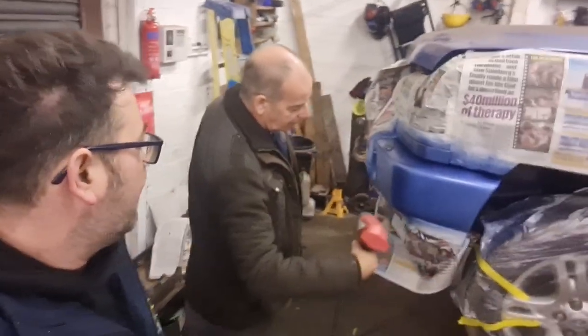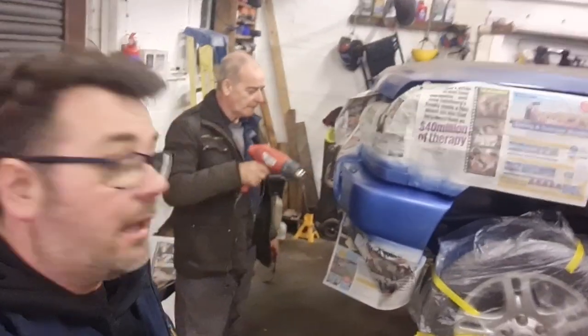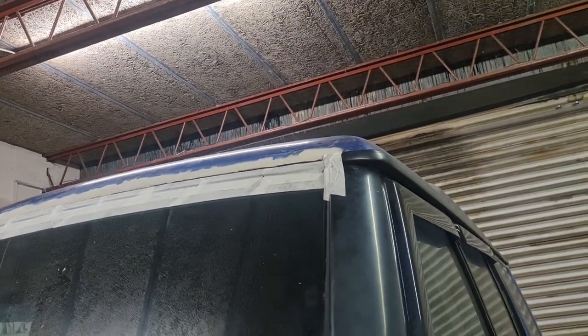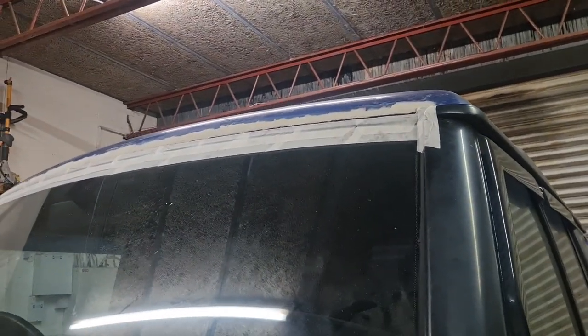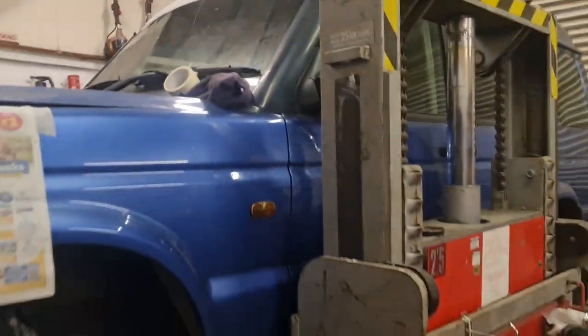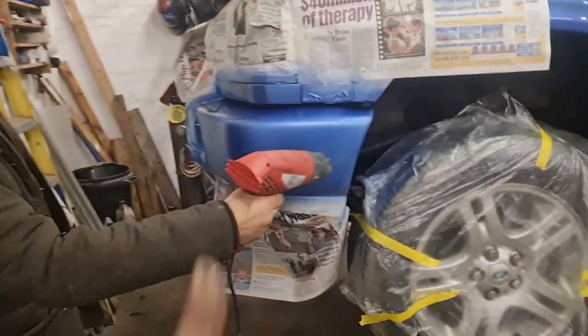Hello, welcome back. We've started spraying the bumper — it's just been rubbed down and then painted. We're going to do a few coats and then put some clear coats on it. Up top there we've taken the seal off, rubbed it all back — there were no holes luckily, just a bit pitted. We've put rust protection and rust converter on it and filled it. We'll rub that down and paint up the top of the windscreen, then tiger seal the gap and tiger seal the seal back in — that should stop any rain. This will start looking good once it's had a couple of coats and the clear coat is on.